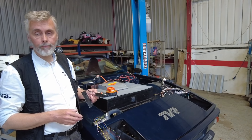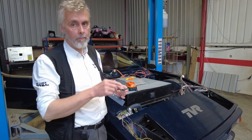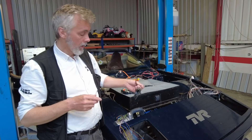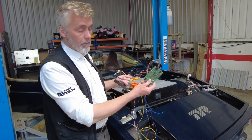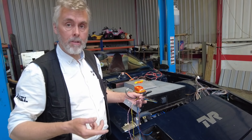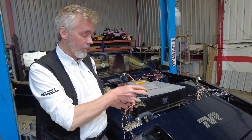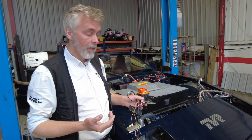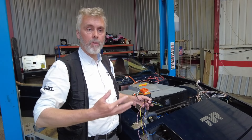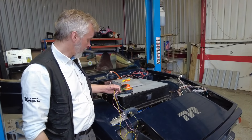What stops the Cellguard activating by mistake? All of these are connected on the CAN bus together to our main control unit developed for your vehicle. It's got the CAN signal from three of these and three isolation monitors, and it's also looking at the auxiliary contacts on the contactors. It'll look at the signals and ask: is that plausible? It's not a case of you've just tapped it with a hammer and suddenly it thinks the car's crashed. It's a case of has it had a G signal in a certain direction for a certain duration with a certain profile — if so, we've got confidence that is a genuine signal. It's a complex bit of kit, and it's how we process it in our main vehicle controller that really matters.